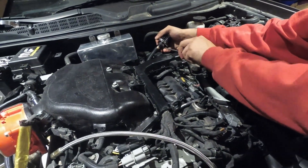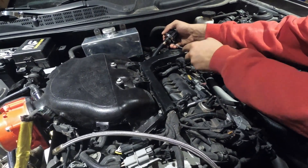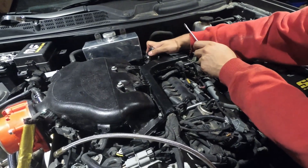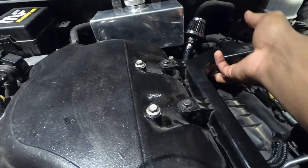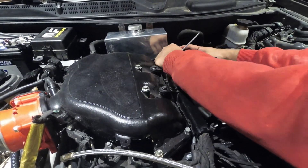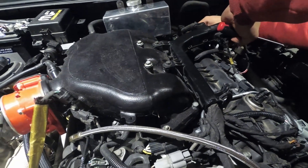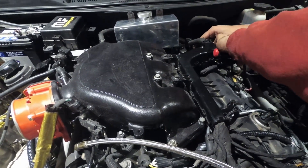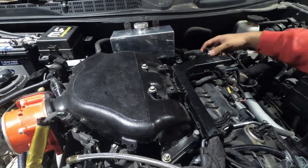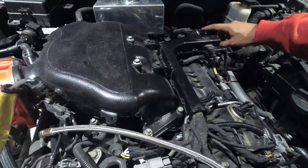Once you've installed it, it basically just sits in the back and will not vent anything into your intake — it just vents to atmosphere, which is perfectly fine. You can tuck it away however you want, rerouting it so that if anybody looks under your hood it looks like everything is hooked up. That's one way to route it; you can also bypass the whole hose and just have the breather sit right on the nipple and clamp it down.